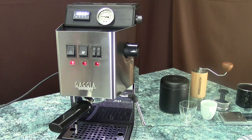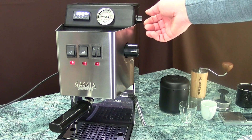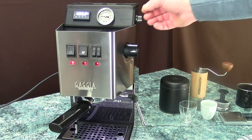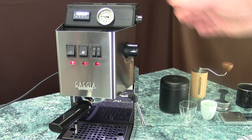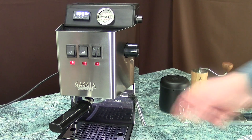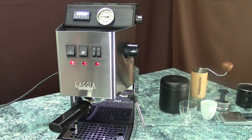But if you have a loss of pressure too quickly while the temperature is kind of linear, that means you're not adding enough water and you will notice a drop of pressure quite quickly. So once you tune these in — it takes some time, it takes some practice shots — but once you've dialed in your steam boost, you can turn on your steam, leave your machine there, come back in an hour, and it will steam in the same way with the same powerful steam output. It will never run out, your boiler getting replenished continuously, meanwhile maintaining an ideal temperature for the steam. I will show this at the end of this video.